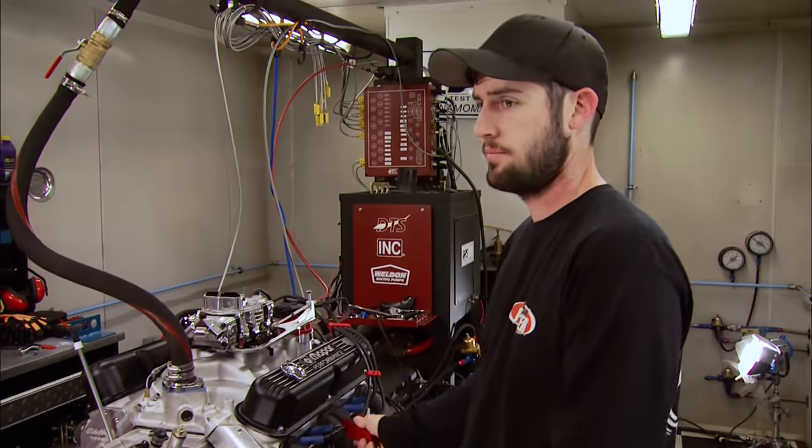After more than a hundred years, the carburetor still has the same basic job: converting liquid fuel into a vapor and mixing it with air to create combustion. We're kicking off a carb tech series starting with the basics. To identify your carburetor, find the list number on the side of the main body or the front of the choke horn, then look it up online or call the Holley tech line. Holleys have two booster styles: the straight leg booster on vacuum secondary carbs, and the dog leg booster on competition carbs. The booster style helps atomize fuel more efficiently from the squirter for better acceleration.